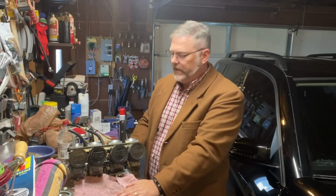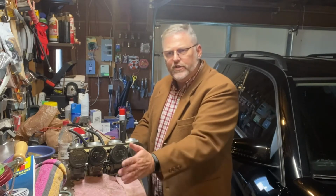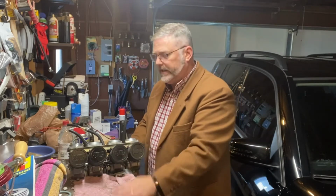I've got those new jets. I did it the old-fashioned way. I didn't mess with the pods. I just went ahead and cracked them open and put in a new pilot jet and main jet, and you'll see those in just a moment when I open them up. That's kind of where I've been this week with this project, and you can take a look at what the inside of these carbs looks like and how they function.